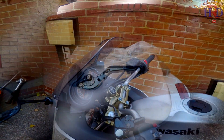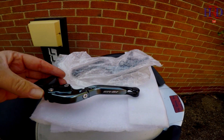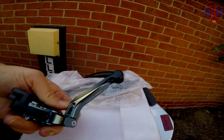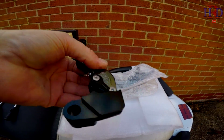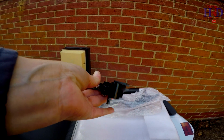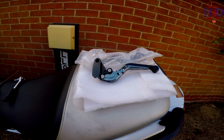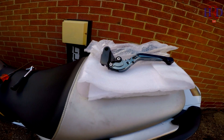So I'll have to loosen that to get the clutch lever I'm going to be putting on. There's the ER6F on there, which is a nice little touch. They're nice looking, they're adjustable — you can undo this and lengthen them if you want them longer. They're foldable as well. All pretty much the same on the other one, but the brake side will obviously be a bit different. I've also got some copper slip — you should really use silicone grease, but copper slip will do for now. That'll prevent corrosion.